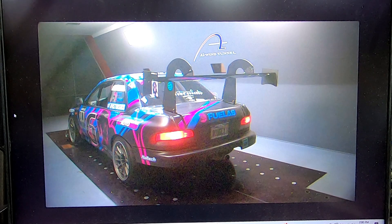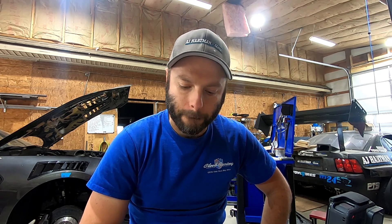The ones on this Subaru weren't the best of those tested — I'll phrase it as they were the least bad. The rear glass on the yellow Mustang chassis isn't very steep, so we knew the benefit might be limited there. Subarus are known for their steep rear glass, so this was our first time testing on one. We didn't have a ton of time in the tunnel that day, so we took the best generators from that run and tested them here — and the results were so-so.